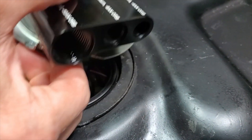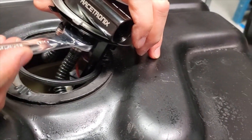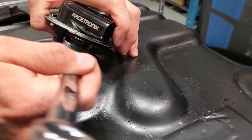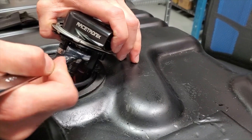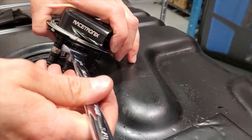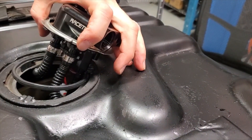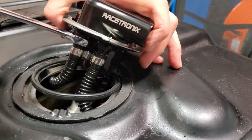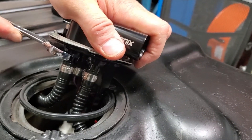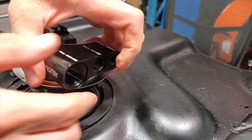Once the fuel tubes are in a comfortable and relaxed looping position, tighten the crescent locks. You don't have to use a lot of force — remember, the O-ring on the shaft is what makes the seal; the crescent lock just holds it in place. Put the 5/8 wrench on the hex portion of the crescent lock, make sure it's properly engaged, and just give it a little nudge. Don't reef on it too much. Do pump number two the same way — just give it ever so slightly to seat nicely. You don't want to strip anything. Now it's locked in place.